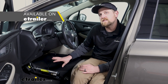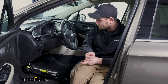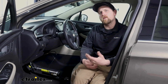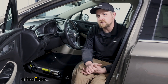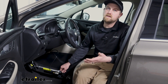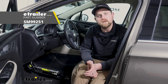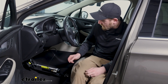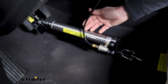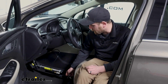There are also other variations of this kit that will work with certain different types of vehicles. But if your motorhome is a smaller motorhome with regular hydraulic brakes like a passenger vehicle, this isn't going to be a good option for you. The good news is there are a lot of different kits out there that will work. I'm a fan of the Stay and Play Duo — it's made by Demco and it's a really good kit. That one is a permanent type kit that stays with the car, whereas this one is kind of a hybrid. A lot of the components permanently stay on the vehicle, but this piece you can remove and take out.